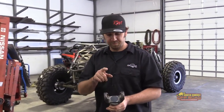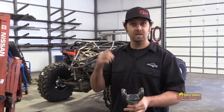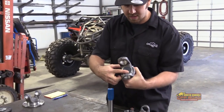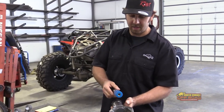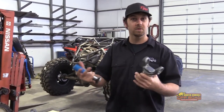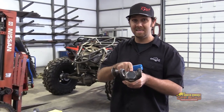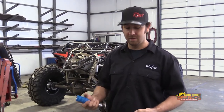We have a little cap sitting on the backside where the drive shaft spline goes inside. If the drive shaft did bottom out, it knocks that cap off and gives you a little bit more safety, so if you bent the lower links or something, you're not going to break your transfer case. You can also see if you're bottoming it out without having to go through all that measurement process.